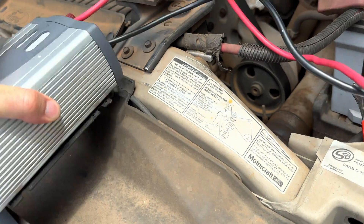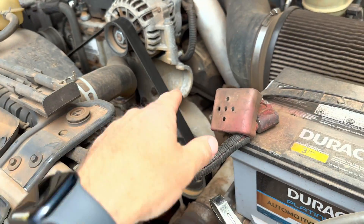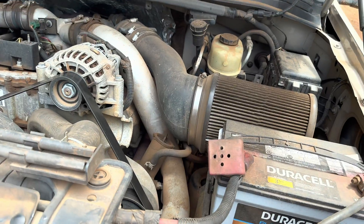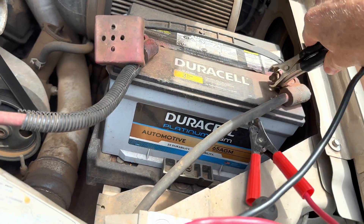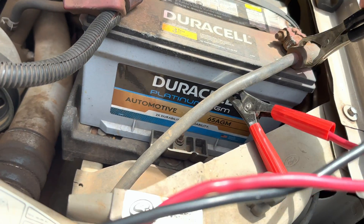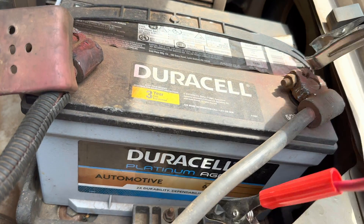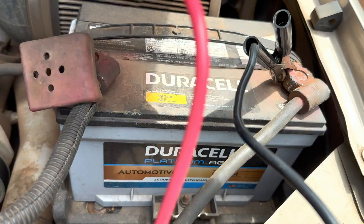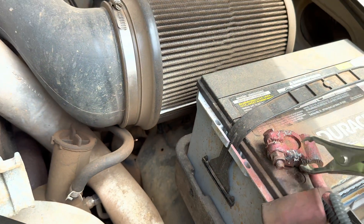It's recommended to make sure the inverter is far enough away that it's not going to jiggle down and get caught up in the belt. I'm going to lay it down right here, then clamp my negative on first and find a good spot to place it. The battery cables are kind of small, so position it securely like this. Then I'll take the positive and do the same.